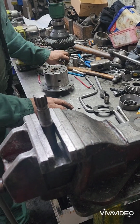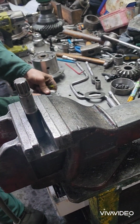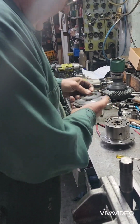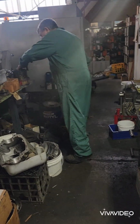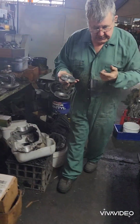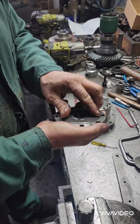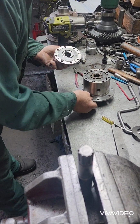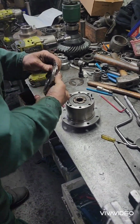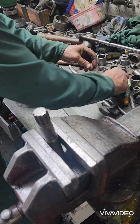It's the last one of all. Now you've got to get this substitute one out. And you can put this one in. Now it doesn't pinch. If you put it in that way, when you're bolting it together, it might overlap. So you put a bit of this grease in there, which stops all that. Bulldozer grease, this stuff. So now, put that in there, see, so I can't alter. So now that's got both in each side. Now we've got these carriers marked here. It's marked there. That one's marked. That's it.